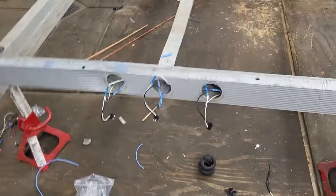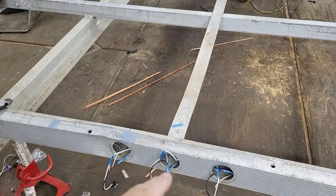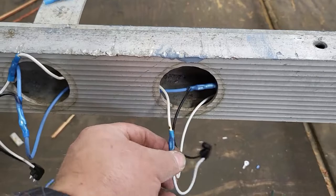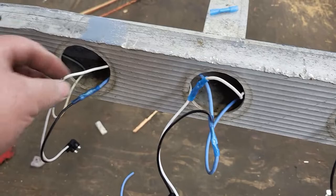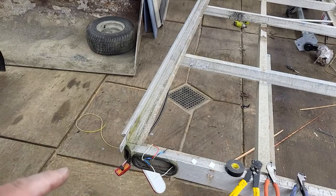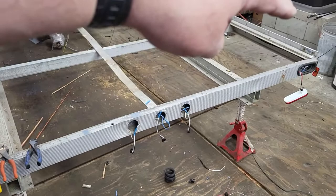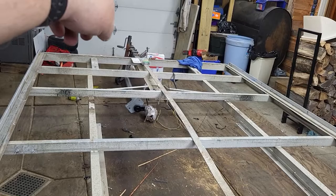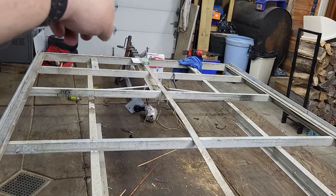So I showed you what I did there - we got our blue wire and this is all the splicing I had to do. These are all waterproof butt connectors as usual. Here's my ground rounding this wire - comes back out, comes into here, splits again for here, splits again, and I have it coming down here connecting these lights. My ground runs from here, grounded right there screwed to the frame, up through there, and then it runs from there all the way to the pigtail. So that light's grounded on its own and that light's grounded on its own. I have one grounding point for all the rear lights, and that's behind here.